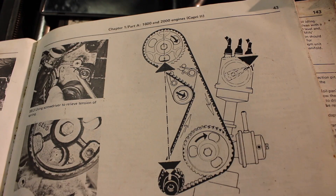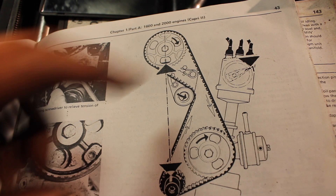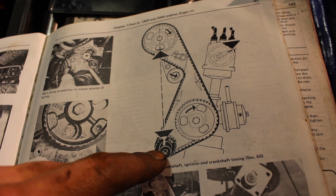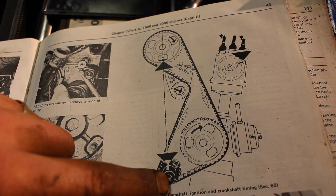Looking at the diagram in the Haynes manual, we can see the arrow — it's part of the plate that sits behind the camshaft sprocket — and we can see the dot that's punched in the cylinder head. You can also see the crankshaft for reference. This is also a method of timing it if you don't have the sprocket on: line up the keyway directly in line from the centre of the crankshaft to the centre of the camshaft, and that line should also pass through the arrow and the dot.